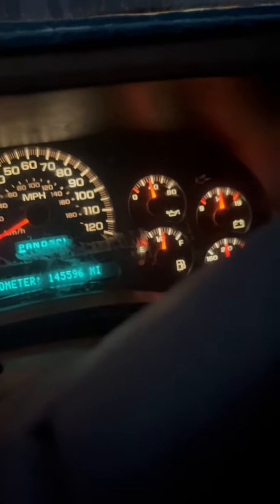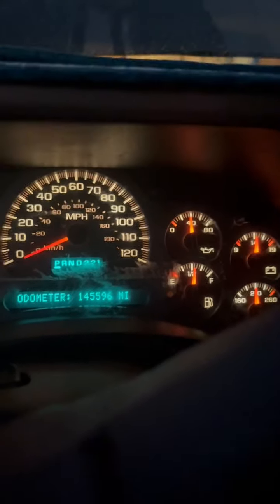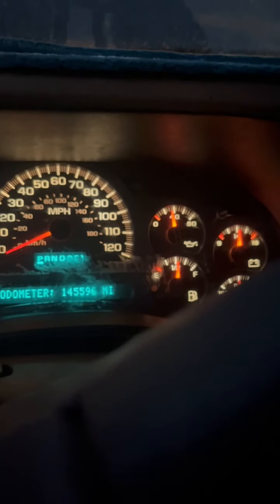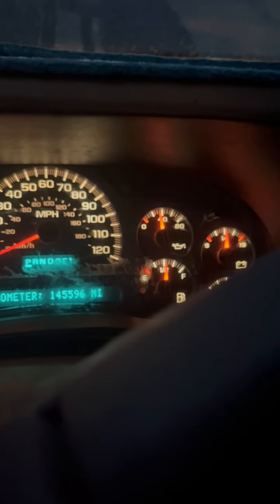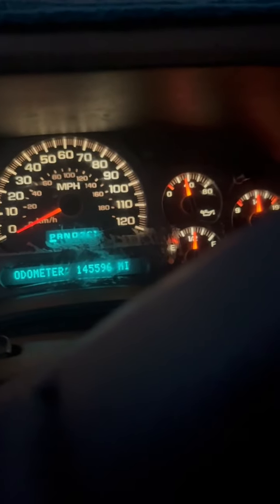This is the end result of the no oil pressure issue on the 2003 Silverado. You can hear this thing running. I had it running for about 15 minutes now. When I first started it the oil pressure went up to 42-43. After running for 15-20 minutes, oil pressure sits at 39. Before I did the oil O-ring, the oil pressure dropped down to zero — like 10-15 minutes after starting it had dropped to zero. So the oil pressure pickup tube O-ring is a big deal in this truck.